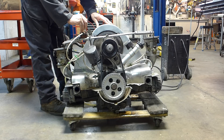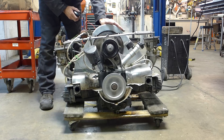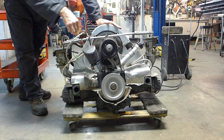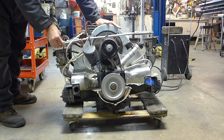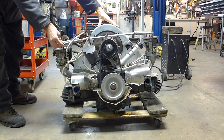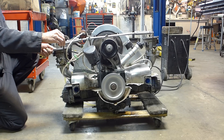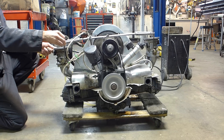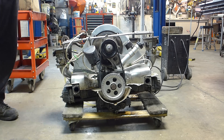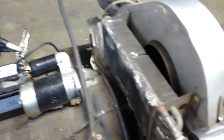Give a little oil pressure there. [Engine starts and runs briefly.] So my coil wire, which was hooked to the coil here, got sucked into the fan and pretty much shut the engine off.